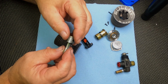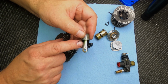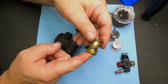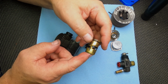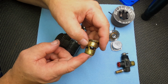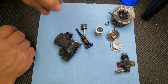Pretty much your standard piston. This is a 16.4 bore. You can see the dimple in the rod. That signifies the 29.5mm rod. Sleeve is a 3-port. Pretty much their standard looking sleeve, regardless of it being the square bore and stroke. When I took it apart, I thought this was similar to a Spec 2, but the Spec 2 is the 16.28 bore.